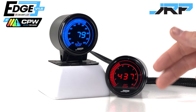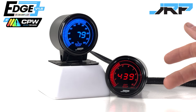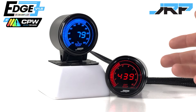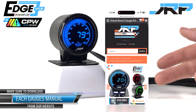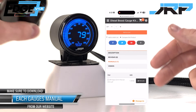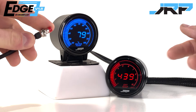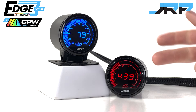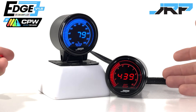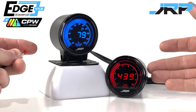Now, just like everything we do here, we've put a lot of thought into how this little function was implemented and could be set up by the user. Of course, you have to be able to customise the colours in the pre-warn function. We will now demonstrate how you can use this. Just as a reminder, you can navigate the menus on all Edge Series gauges by using the button on the back of the gauge, or the remote button included in all kits. For the warning system, you can select any three colours that aren't used as a normal running colour. You can set how sensitive the colour pre-warn is in relation to the final warning alarm that you set.